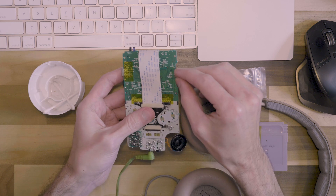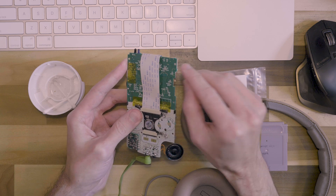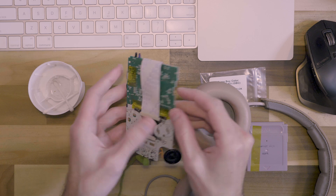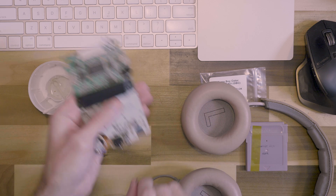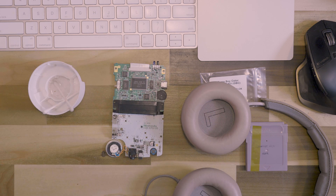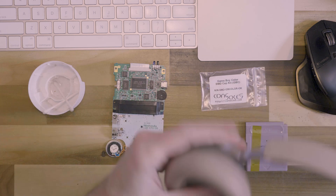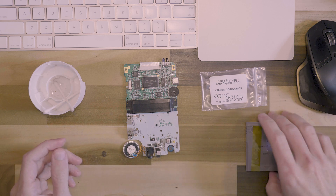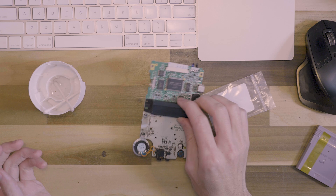Just give it one more try. It's on full volume now — okay, it's sounding much better. But I am going to go ahead and replace the caps because that's kind of the point of this episode. I wanted to show you how I do that. These capacitors don't last very long anyway, so I typically like to replace them on every single mod that I do.